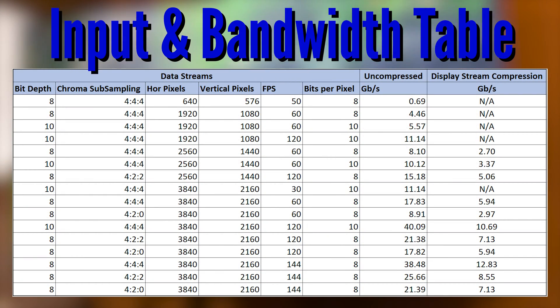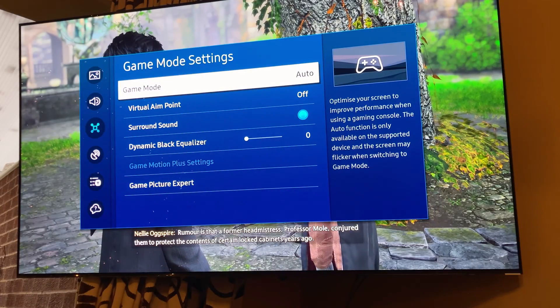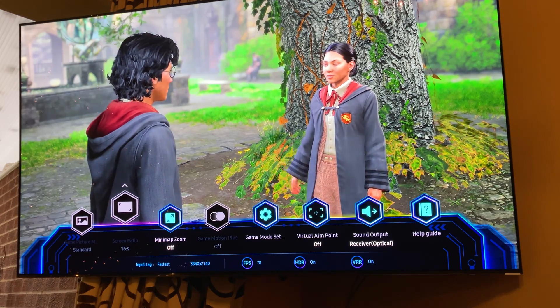The data-centric amongst you may have questions such as: the PlayStation 5's HDMI pushes 32 gigabits per second and the Series X can push 40 gigabits, with the HDMI 2.1 spec itself maxing out at 48 — so how is this going to work along a 10.2 gigabits pipe? Well, first thing is this only impacts capture and not pass-through, as this is all handled directly inside the unit itself.